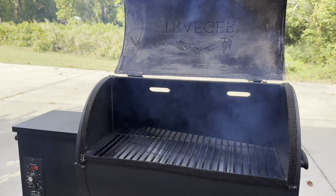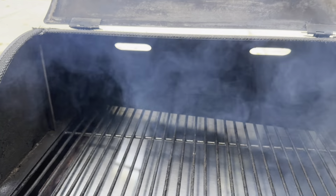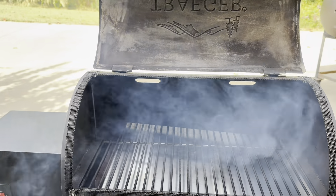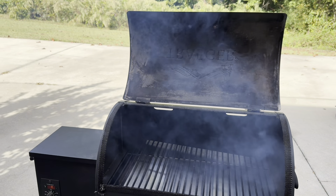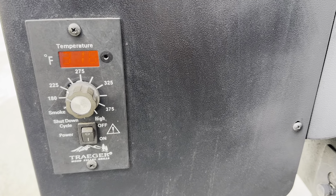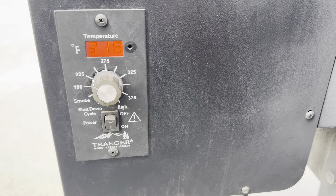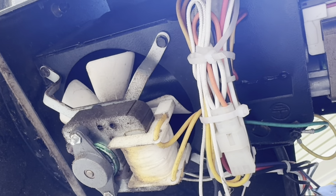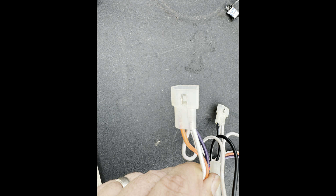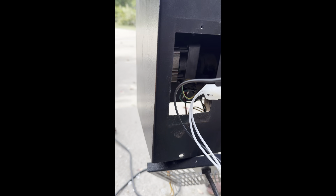We thought it was ready to grill, but the guy I bought it from was open and honest and said the temperature control was varying — it was jumping up 100 to 200 different degrees higher than what the setting was. So now we've got to tackle that, but don't worry, it's not a big deal. You can order these control panels from Amazon as well; they're about $30 to $40 depending on the type of grill you have — basically plug and play. You can see it's almost 100 degrees hotter than the setting. Underneath the pellet hopper you've got a wiring harness; you just clip the zip ties and the best thing is they're all color coded the same, so the universal controller's colors are going to line up. You just undo the clip and pull it out — nothing hard, it's plug and play.